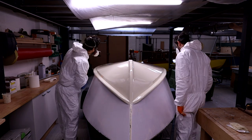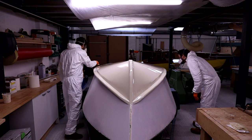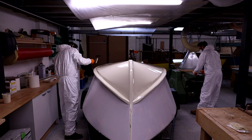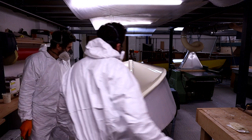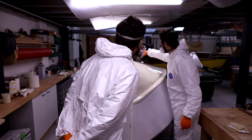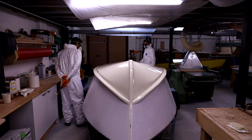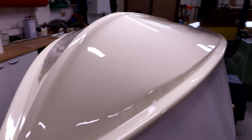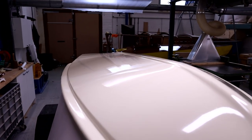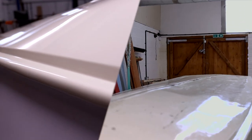These lights are static when on, and when you turn them off they lose their static charge and any dust stuck to them throughout the day drops straight into your finish — so be wary of that in an environment like this. We're also wearing Tyvek suits to keep dust down a little bit and keep things cleaner. When it comes to the deck and sides we'll completely sheet out the area, but for the bottom this is enough to get a good finish. And there's the final result — came out really nicely, quite happy with that. Compared to what we had before we started on this boat, it's a damn sight better; we've come quite a long way getting this thing back into shape.